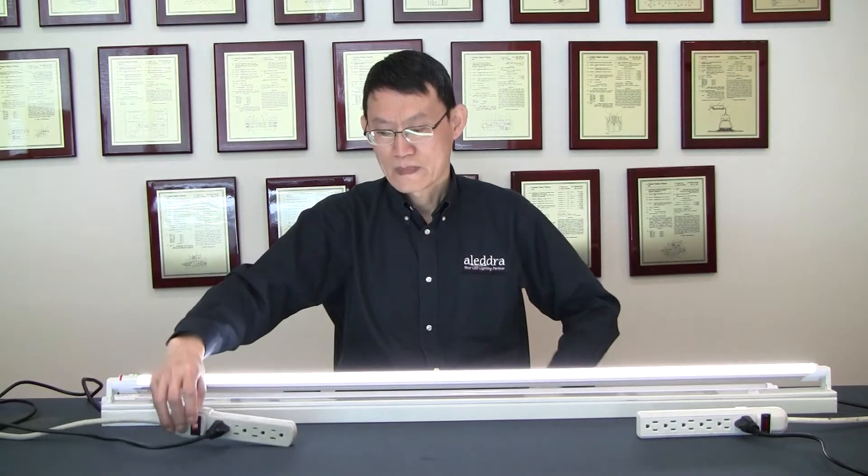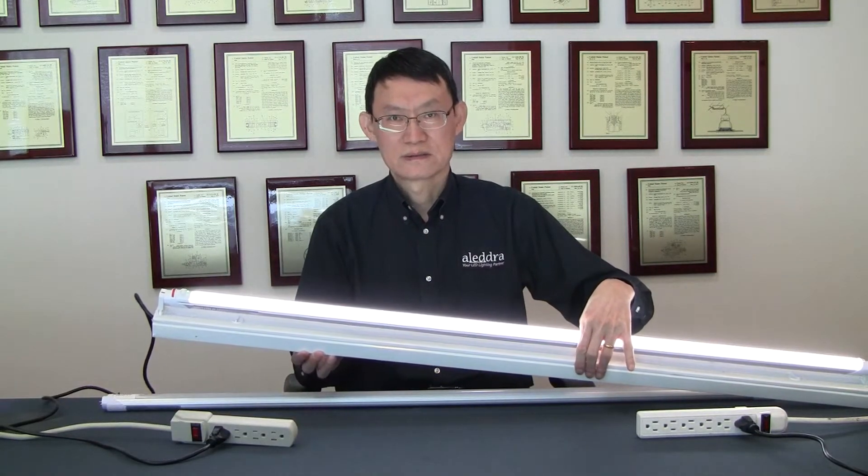But the always-on circuit will charge the battery at all times. Should the power go out — that's the case where the TA doesn't detect any power from both the socket — then the battery kicks in, like this. It lasts more than 90 minutes when there is a power outage.